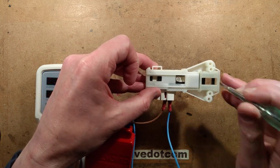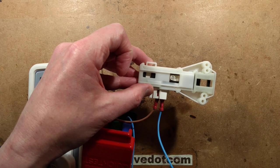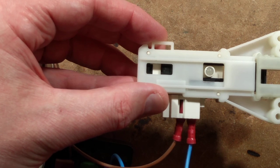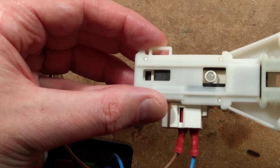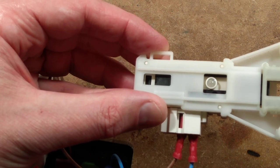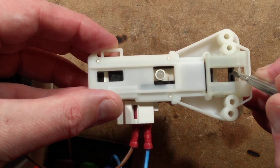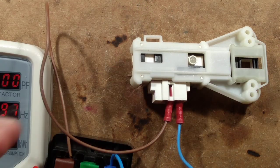If you look at the end here when that slides back, you'll see the little plastic pin under it. That little pin is about to pop out, and when it does pop out this won't be able to go back. In not being able to go back, that would prevent the door being opened.